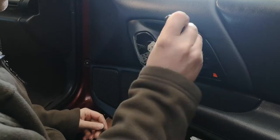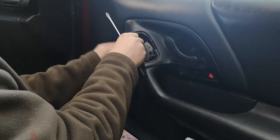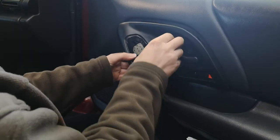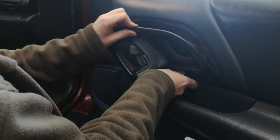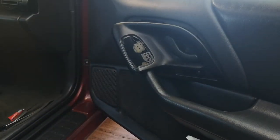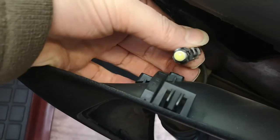Now we've got the screw out from the centre. Get in anywhere you can — I usually bring it in around here like that. Pull this front section away, and that releases the whole clip area around here. Don't worry too much about the actual sliding locking thing. Push that into the locking position as if the door's locked, and that'll allow it to come out a little bit more. That'll actually get you as much movement as you need. Then just twist — and there's your little bulb. No need to take off any of the locking mechanism or around where the door handle fits.